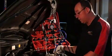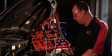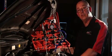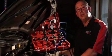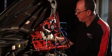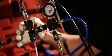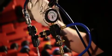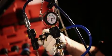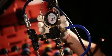Again, to stress — if we've got a fractured hose or a leaky hose, in some cases where cooling systems go into the charge station on the side, we won't create vacuum and we won't get air out of the system. Having said that, we're right to go. First thing I need to do is turn the unit on — we're connected to shop air. So that's charged up, ready to roll. All our valves are closed and you can see zero vacuum on our gauge.